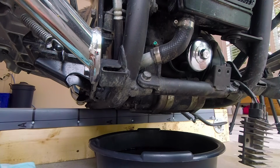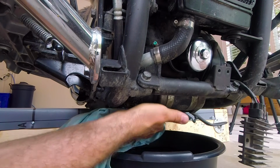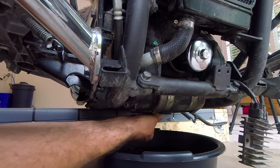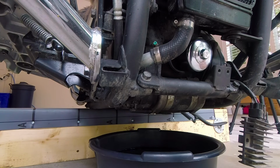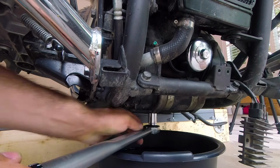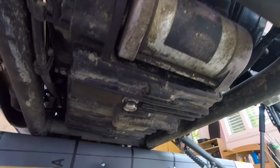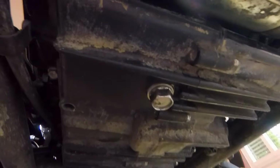Now I put the oil drain bolt back with the new gasket. It is recommended to tighten it to 15 foot-pounds. Done. So you don't want to over tight it and damage the thread, so that's why I use the wrench with the measuring how tight I tied it. I cleaned everything around the filter and around the oil drain bolt.